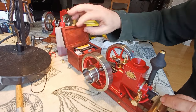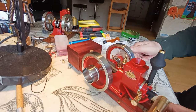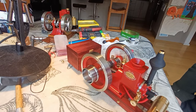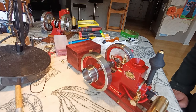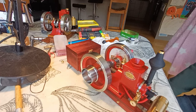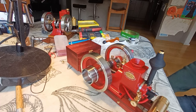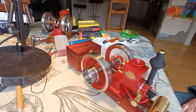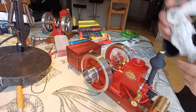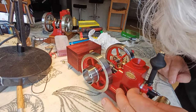Let's just see if we still got the spark. I turned the spark off — let's turn the spark back on. Oh-ho-ho! Miles, come have a look man! Straight out of the box — wow! That's gorgeous! Oh-ho-ho-ho! I'm not bad, am I? That's really good. Let's do some tuning. Too rich — so we'll just lean that off a little bit. Choke fully open, choke fully closed, choke fully open. Needle all the way shut there.